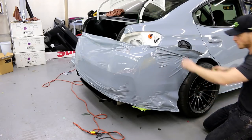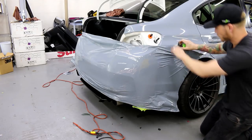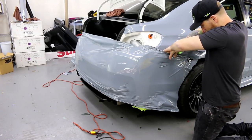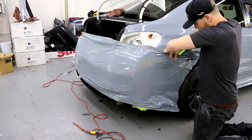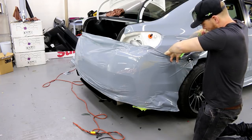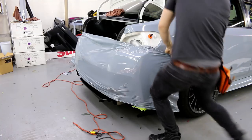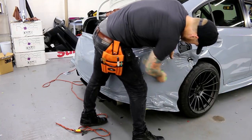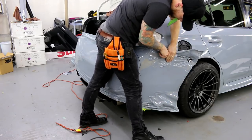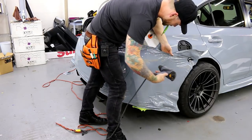All our wrinkles are running across, more or less. This one isn't, it's a little bit. All I have to do is pull this way. So I'm gonna put a magnet there. See, what happens when you don't get your hands close enough is it's harder to get to the wrinkles that are running across. So I'm gonna heat this down and let it shrink, as it will, right?